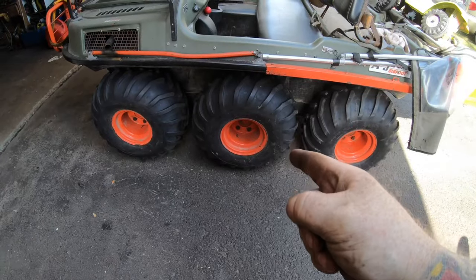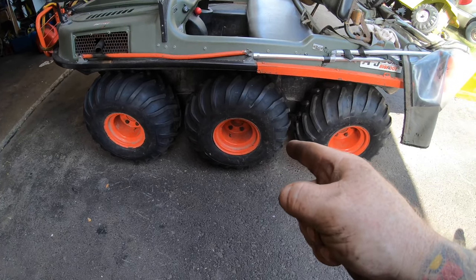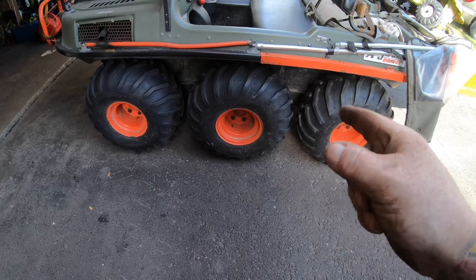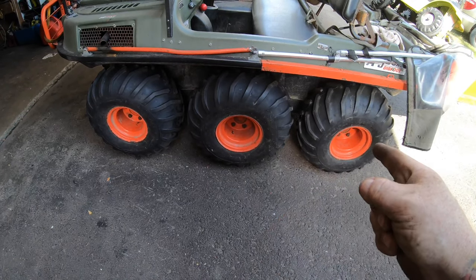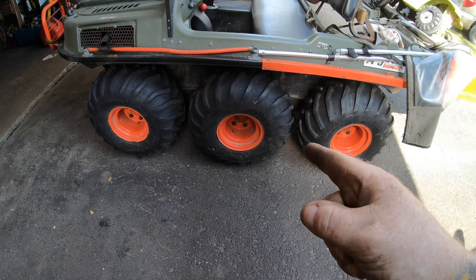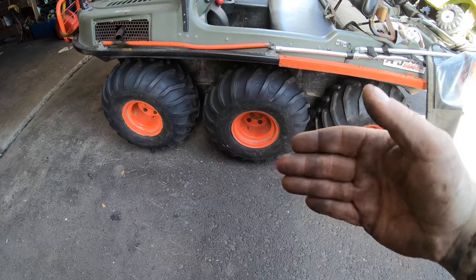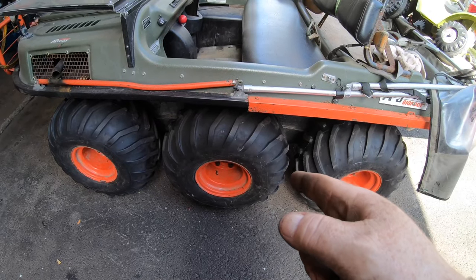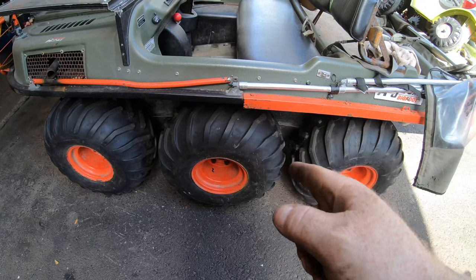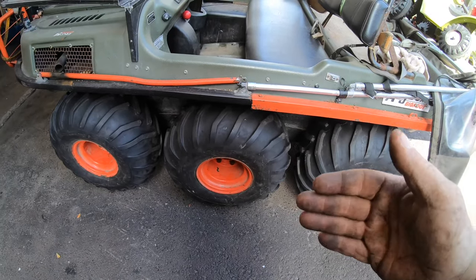Right on, I'm glad you got the Bigfoot tires on. Now my middle tire, I put max air pressure in it, which is 7 pounds. My front and back tires, I only put 4 pounds. That's so the middle tires are a little bit bigger and it helps it turn. Pro tip. I'd also recommend you 8-wheelers doing the same thing. Your two middle tires are inflated just a little bit more than your outside tires. Help you turn a little bit better.